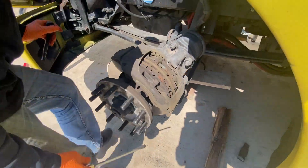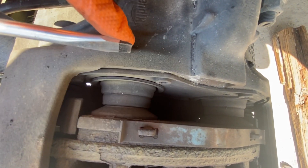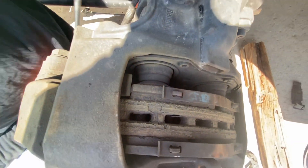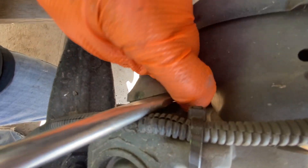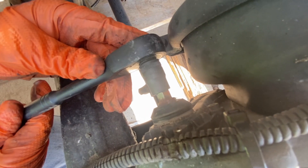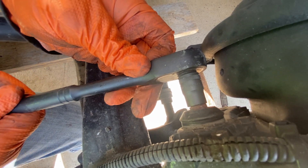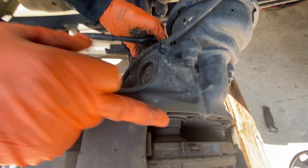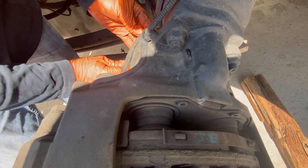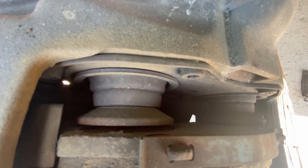These two pistons right here need to go back this way. You've got a little plastic rubber cover here, so you just kind of remove that out of the way. You'll see a rusted nut there — that's where you're going to need the 10 millimeter socket. It's just left-loose, right-tight. So we're going to go left. As I'm turning, you can see how the pistons are slowly moving back. Left-loose, right-tight — it's just pretty simple.